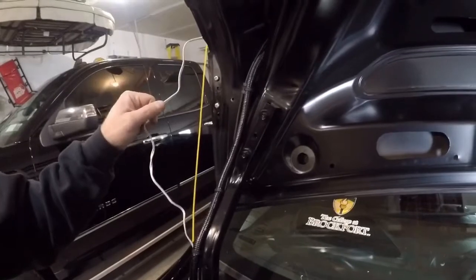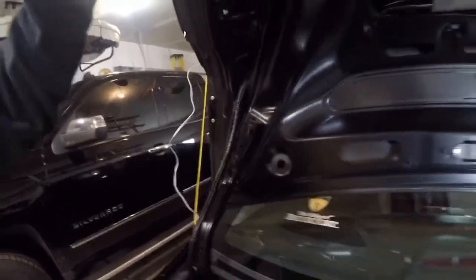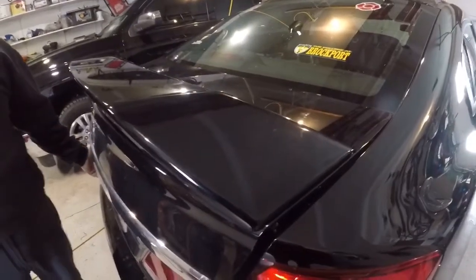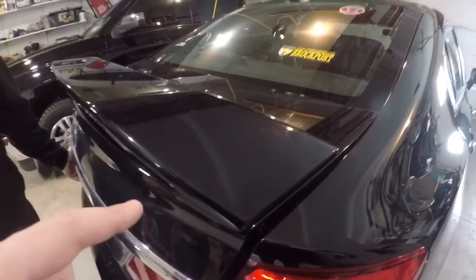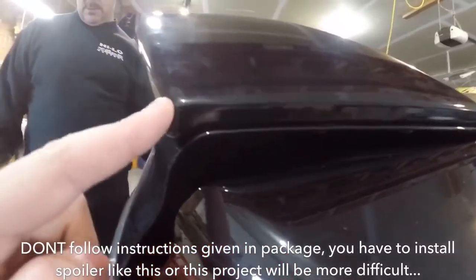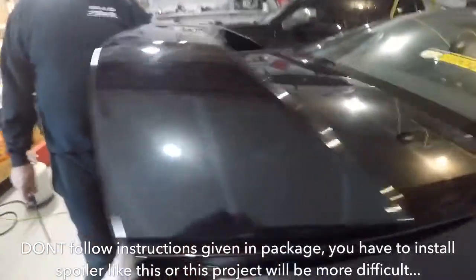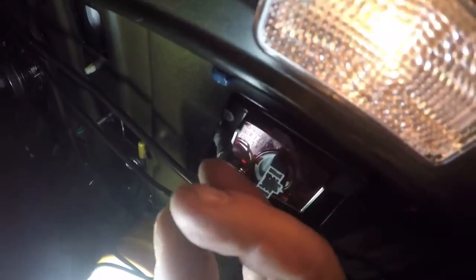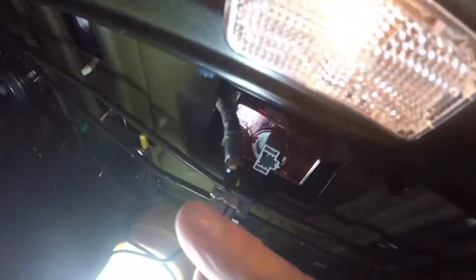This is just a check — tight fit and we are lined up perfect. This is what the finished product will look like once we get the wire on. A key thing to remember when installing a spoiler like this on this kind of Civic is make sure the end is exactly hooked right over because it fits flush just like that. To access the brake light, you go underneath and here is the cable — you unplug that and then take the one that came with the spoiler.